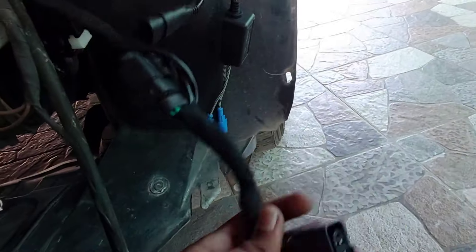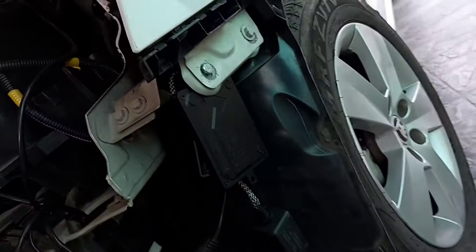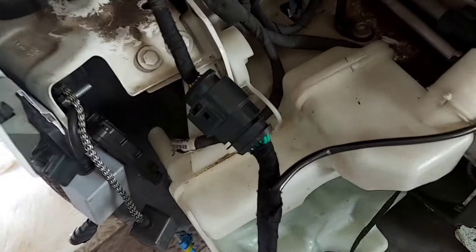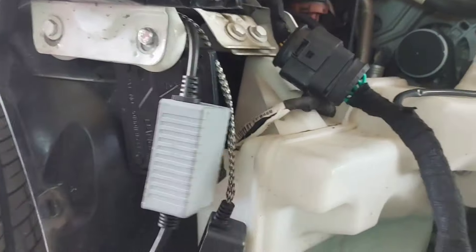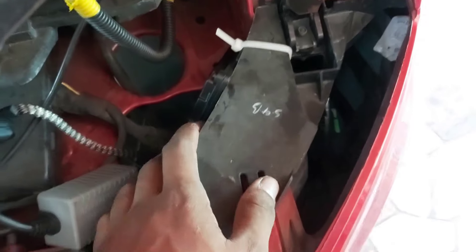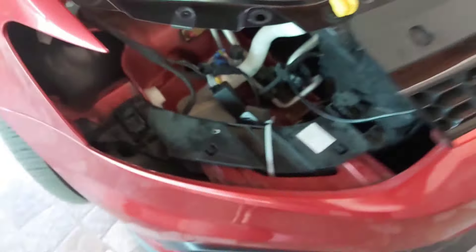This is the HID kit used for the xenon lamp. I installed this HID kit on both sides — the input for the right side lamp comes from the left side via the relay, connecting to the male coupler. All the relay and HID kit components are kept away from the engine bay and fuel area — you can see it's just behind the wheel liner. On the Polo, it is placed just beside the headlights.